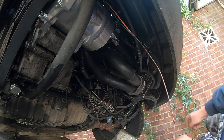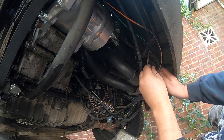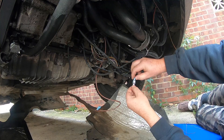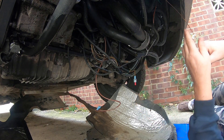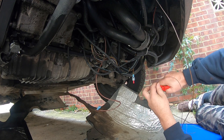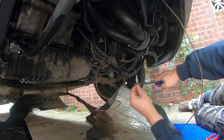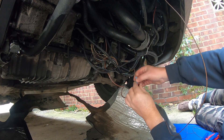I'll now pull through the earth wire. So what I'll do is run these two pieces through some conduit. I'm going to hook this earth up to the earth that runs to the engine block, using a piggyback connector there. I'm going to run this around to there. Hook it up. There we go. Dare I say the finishing line is in sight. I don't want those coming loose — I'm having all sorts of earth problems.